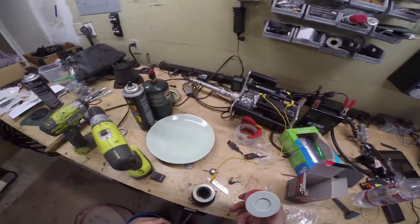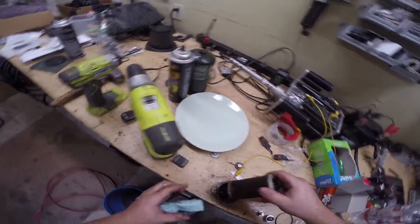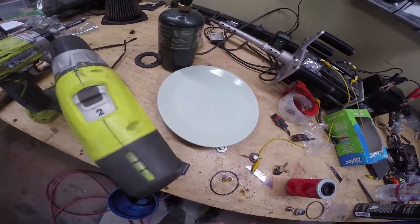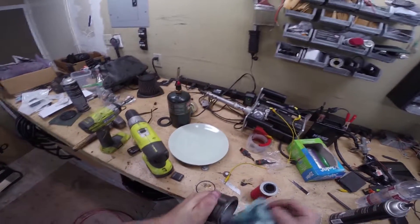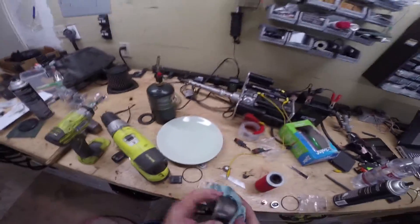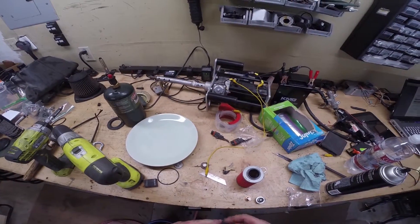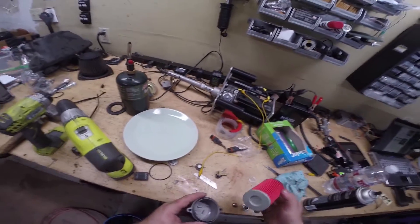It's very important to drain from both sides because you can see there's quite a bit coming out that other side. Make sure you put this in the right way — this part goes inside the cap. So we're just going to take that out, clean this off, and take that O-ring out. You can see it's starting to get a little step in it, and that's bad — if we put this back on without a new O-ring it wouldn't seal very well. Make sure you get all the brake cleaner and old oil off of it.